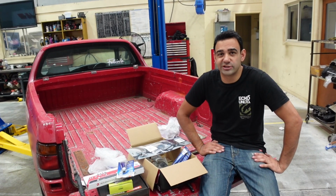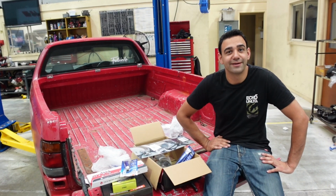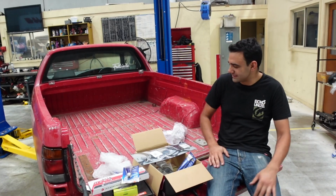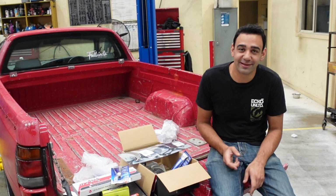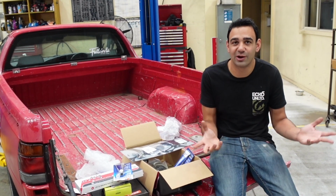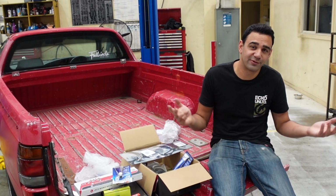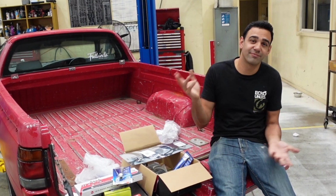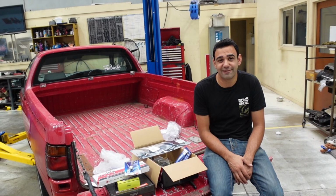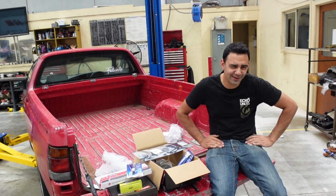I also ordered their chipped ECU, which I hope is maybe in that box, because I can't see it. And probably should have opened this box many months ago to make sure it was all in there, but anyway, fingers crossed it is. They're just a reprogrammed memcal, they call it, and essentially you just replace one board in the ECU, so it's not a whole ECU or anything like that. Nice and cheap. My old Ute had it. I never got to compare before and after, but everyone does reckon it picks up, particularly in throttle response, which is going to be a key thing. Not overall in maximum power. They definitely play around with the timing and fueling, and it is supposed to be even more fuel efficient as well, because that's what we're going about in this thing.